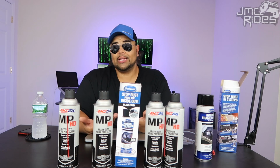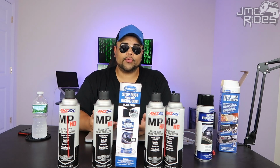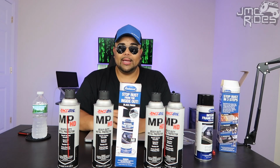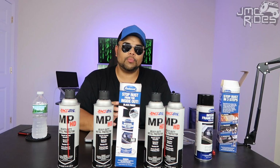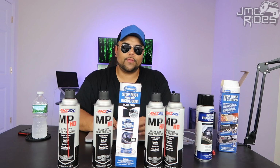You're going to get salt. If you're driving in the winter, with all the salt that's on the roads, you're going to get salt in there too. You off-road and go through a water crossing, you're going to get muddy water in the frame. It's going to get disgusting on the inside of the frame, and it's not even about being disgusting, it's more about it getting rotted out from the salt and all the junk that's inside your frame.